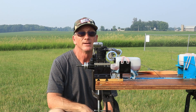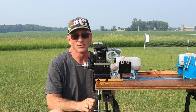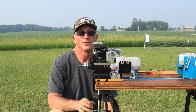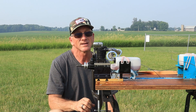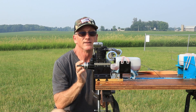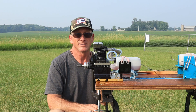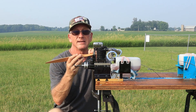This is an engine you don't want to mess around with, because when it gets too lean, exactly what you just saw can happen. I was running my 220A last week, leaning it out to the point where it was starting to drop RPM, and it was not knocking and certainly never detonated like that or threw a prop. That's probably attributed to the design, the timing, or the cam shape. This is the original 150S and it was an aggressive engine.